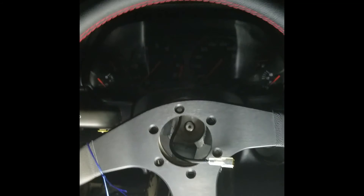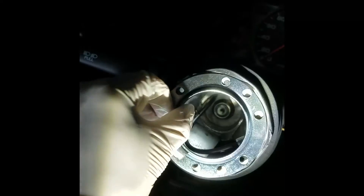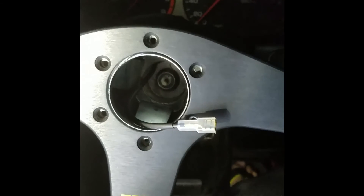Installation is pretty much self-explanatory. Once you put the hub on, make sure this arrow that says 'top' points up. Then get the steering wheel and place it on just to make sure it's aligned, because if it's off by one tooth the steering wheel will be slanted. Put this nut back on and torque it down to around 80 foot-pounds of torque. Then, using this ring, place it on top of the hub and make sure all the holes are aligned. Place the steering wheel on top of the hub, then connect this plug to the horn and push the horn in.